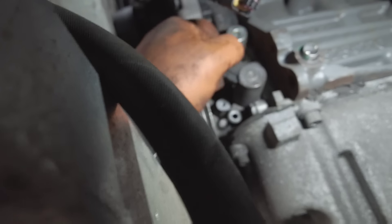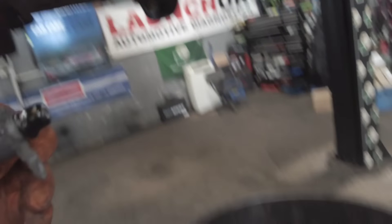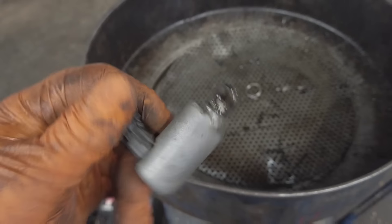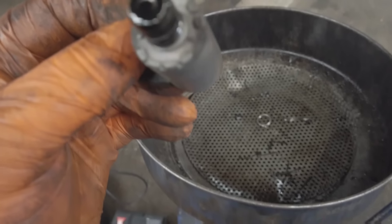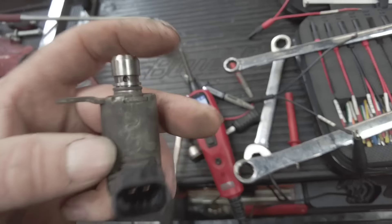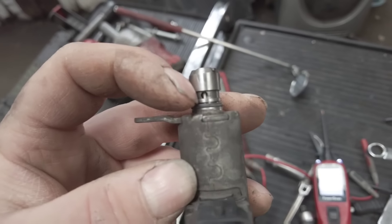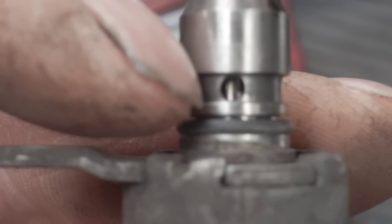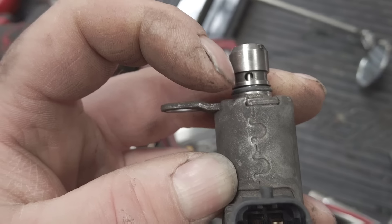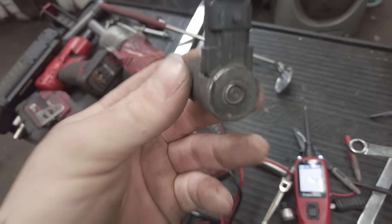Side to side — you might have to get yourself a pair of pliers. Also get yourself a little receptacle just in case any oil pours out, which is a tiny amount. Now with that little solenoid off you can bench test it again. It's not operating as I thought it would be — there's a little plunger inside that lets the oil through, and all it takes is a tiny little bit of carbon to get underneath it and keep it stuck.